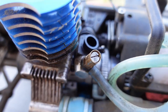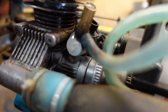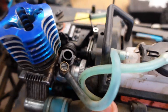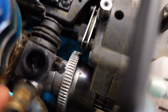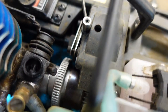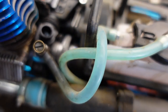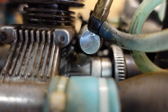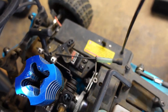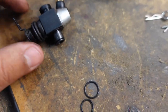Maybe that o-ring is bad, or maybe it's cracked — it is plastic. I'm gonna go back into the garage, take it apart, and see what it is. Hopefully I can take this off and it's just a bad o-ring. I've never had bubbles showing up like that with any other carburetor. Every time I'd pull on the pull start, it's sucking air from there and showing bubbles at the top. I think it's just that golden nut right there, plus take off the fuel line and servo link.